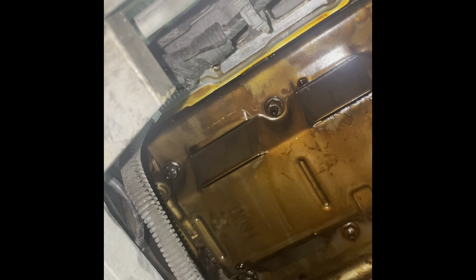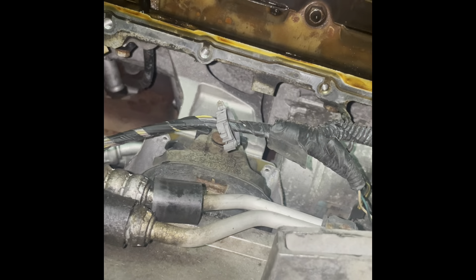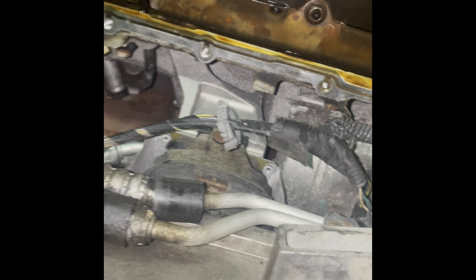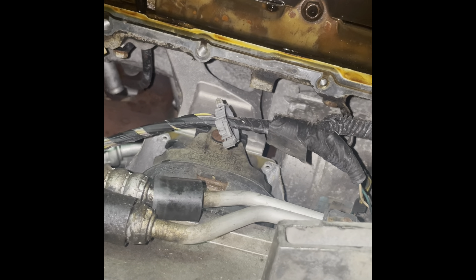Stick this part up right there, put it on, and tighten the nut. Then just shove it up in here so it kind of locks in place and then tighten it down. Now before putting things back together, we want to clean off the old gasket — just get a razor and go all the way around and get it all off the best you can.